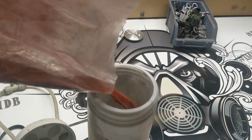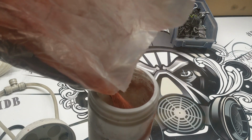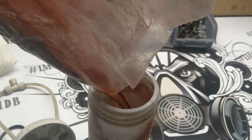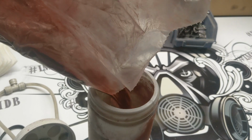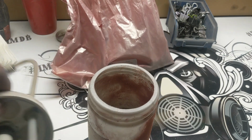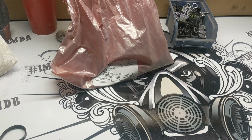So I'm gonna go Illusion Cherry for the base coat. For those of you that don't know, that's a dormant candy, meaning it needs a clear to activate the color. So we're gonna put this down, but instead of using a traditional clear, we're gonna be using a mix of Silver Sparkle and Adam's Gold. Customer ultimately is looking to have a subtle silver and gold flake.